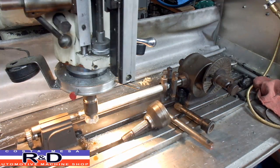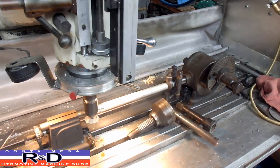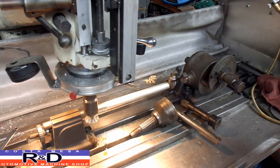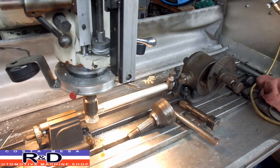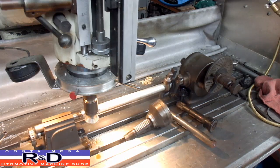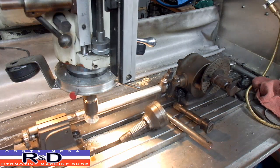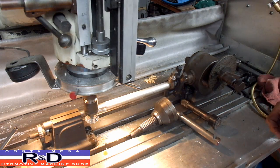Could you feed this in by hand? Absolutely. When I was teaching in the classroom I used to have my students make a gear for a Gilmer belt drive — it had to be 22 teeth — and it was a nice project to learn about the index head.